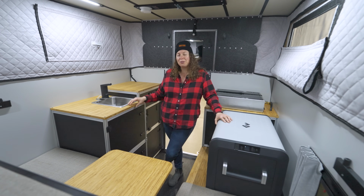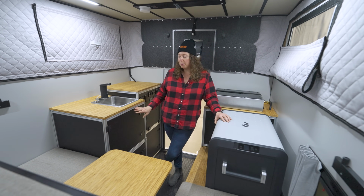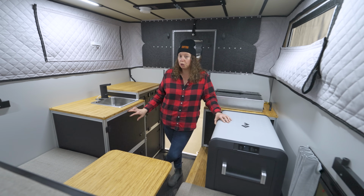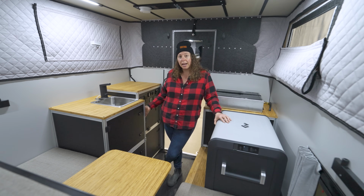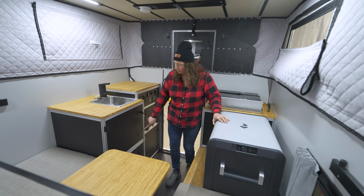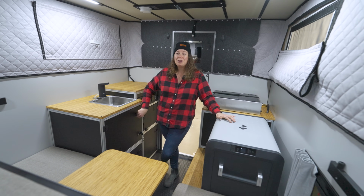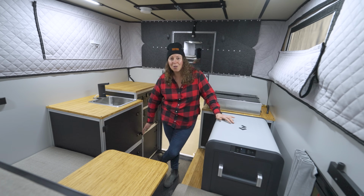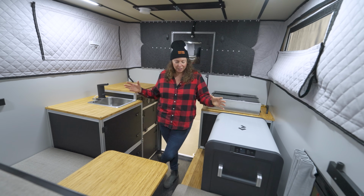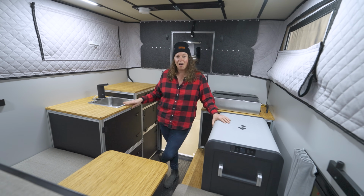Before we get into each individual module location, let's talk a little bit about the construction of the modules. To build these and make them super sturdy, we're using a 1-inch slotted aluminum extrusion with honeycomb side panels and an HDPE door with super heavy duty latches, so that way it's nice and secure. This camper that we're in has been on so many test trips. It's been all the way down to the tip of Baja, and it has held up great. This camper looks and feels like new. Really a testament to the durability of this style of module.